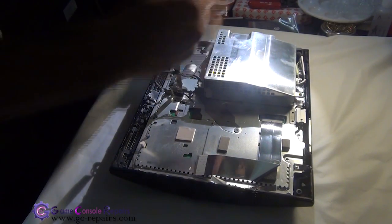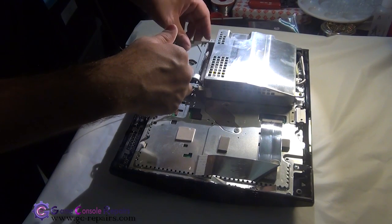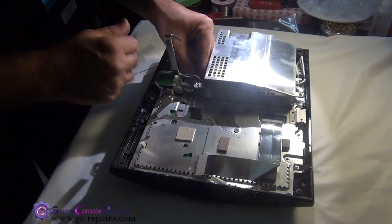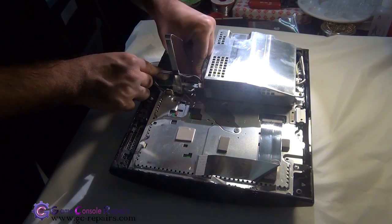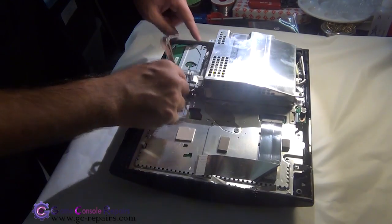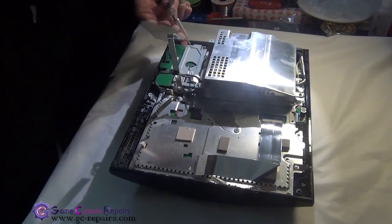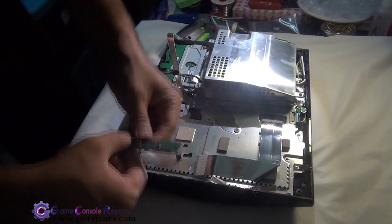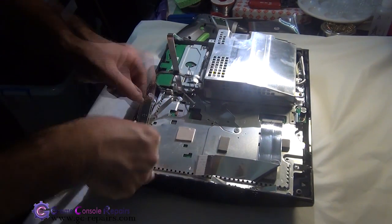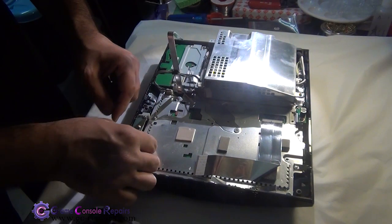Let's place the Wi-Fi Bluetooth module with the antenna. Connect the cable. And place all these 4 screws and 1 screw here. Next, grab your power reset switchboard and place it in. And connect the power reset switchboard cable.